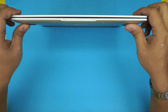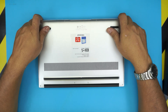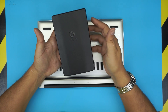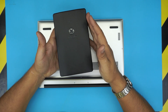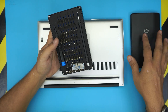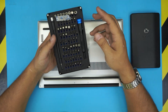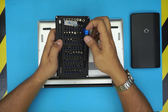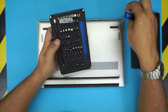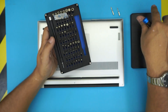In this video I'm going to show you how to open it up and replace the battery. Number one, you need a screwdriver set. I really recommend the iFixit toolset — they have one of the best sets of bits for opening laptops or any other electronics. We're going to be using Torx number five and Phillips number zero.